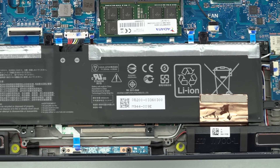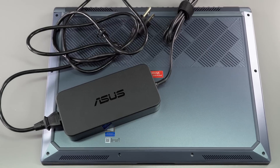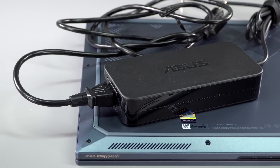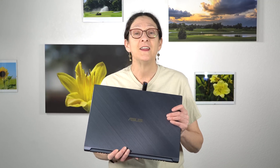The battery is only 57 watt-hours — quite small, comparable to what you'd see on a Dell XPS 13. Even with switchable graphics (Intel UHD 630 for lighter work), don't expect great battery life. In mixed productivity tasks with a little streaming video at 150 nits, we got about four and a half hours. The power brick is 230 watts — sizable, similar to ASUS gaming laptop bricks — and you will need to carry it with you.